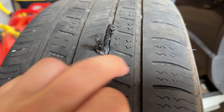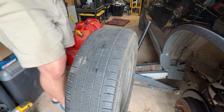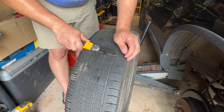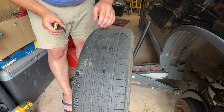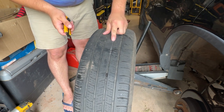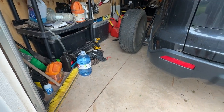That seemed to work. You get this kind of gunky gooey mess, so I'll grab my exacto knife and just cut it flat, saw off the extra. That's what you're left with. I'll just have to fill it back up with air to the right PSI. That should last a little while — she needs new tires anyway, the wear bar is pretty close to the tread, but this will get her through until she gets new tires.